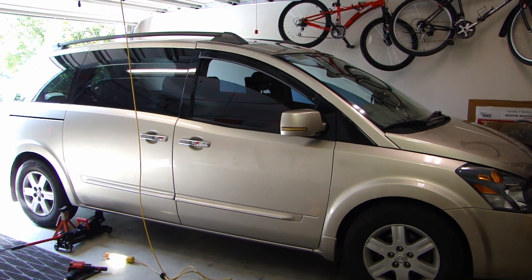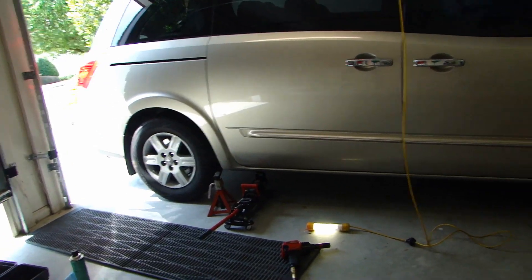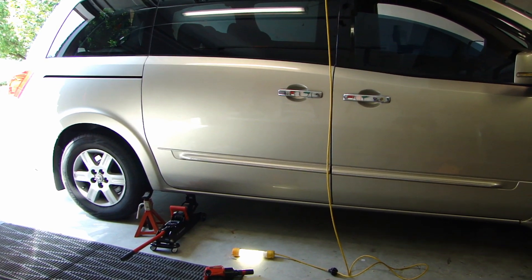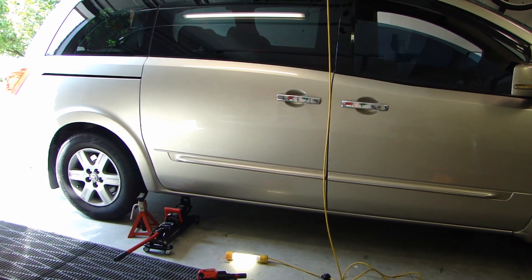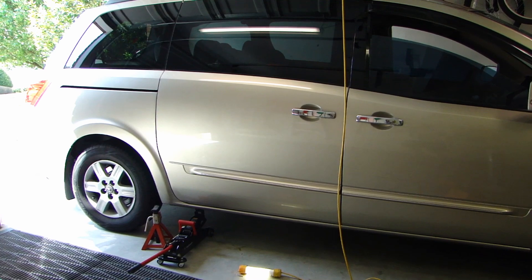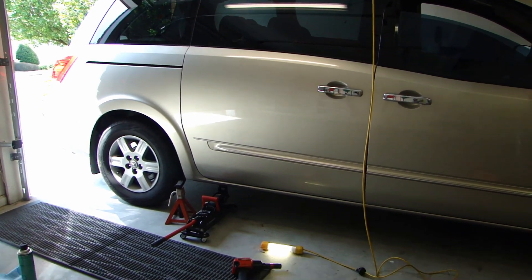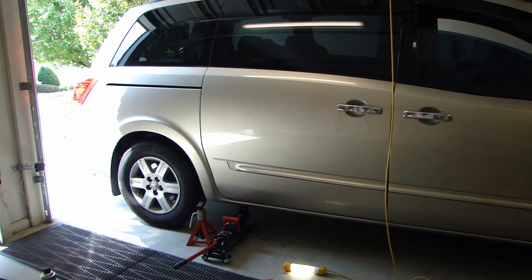Hey, this is Dial2Fast here and in this video I will show you how to replace the rear wheel hub assembly. The wheel bearing at the back - what I've noticed is it started about a month ago, the back of the car you can hear this really loud groaning sound when you hit about 45-50 miles an hour and it's kind of gotten louder over the last several days. So I'm gonna go ahead and replace the wheel bearing. Now this vehicle has 106,000 miles, so I'm gonna go ahead and replace both sides - because even if the problem is only one side, having this type of mileage, most likely the other side's gonna go.